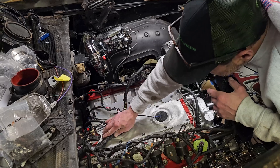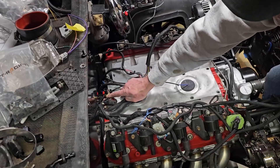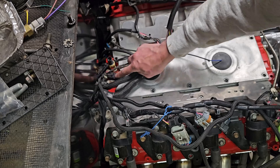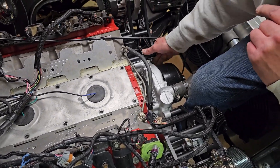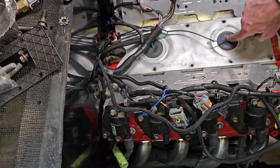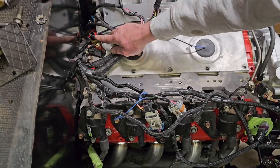One of the things you're also going to realize — this is a Gen 3 motor right here. This is the cam position sensor which I've already plugged in. On a Gen 3 the cam position sensor is up top; on a Gen 4 it's going to be in the front of the motor, so you'll want to plug that in right away. We also got the two knock sensors plugged in, and then our oil pressure.